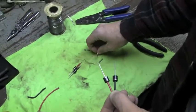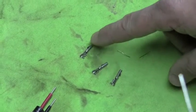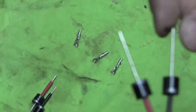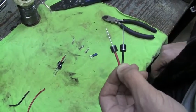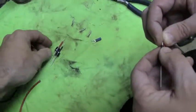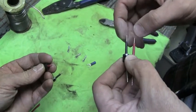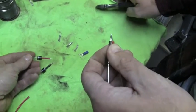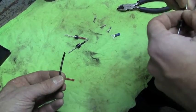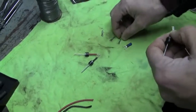We do have three pins here. The three pins are set up so that one will be the neutral of the AC, one will be the positive of the AC, and then we're going to have positive for the 12 volt DC. The extra grounds will go into a fork which hooks to the ground on the vehicle. These little bands he has on here identifying the hot and the neutral — that's just insulation off a number 14 wire, little pieces. They work really handy as identifiers so you know what leg does what, and it also protects it from contacting ground or anywhere it shouldn't.